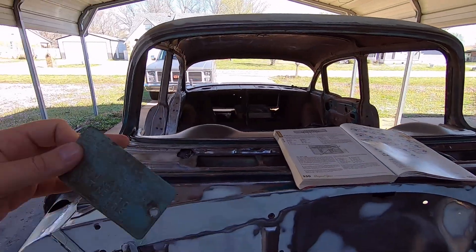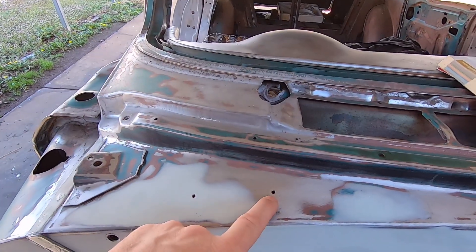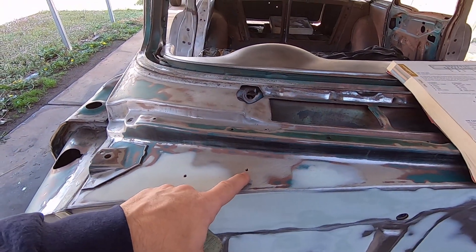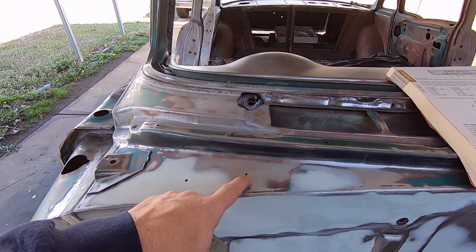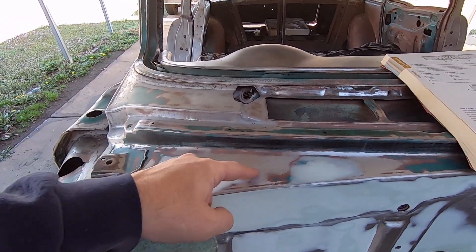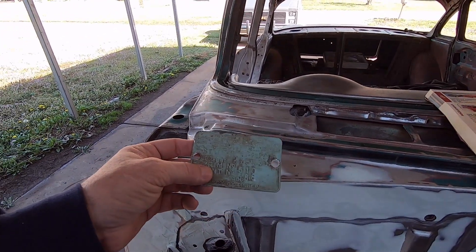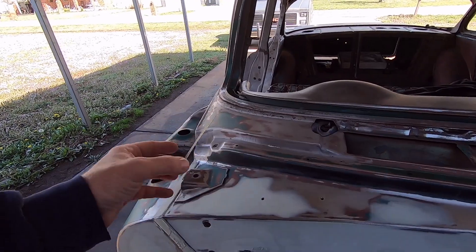This car I'm going for more of an original style. What I did was I step-drilled the hole open a little bit, took a flanged nut — I think it was a 10-24 nut — put a long bolt into it, set it down in there, and welded it all the way around and ground it smooth. So I have a nut welded into the body to bolt this on with some stainless steel button head allens, so it just looks a little better.